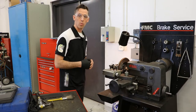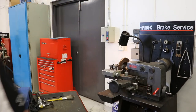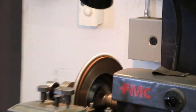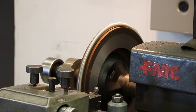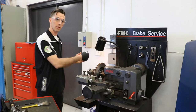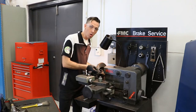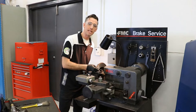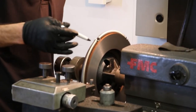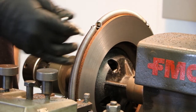At this point, we'll zoom in and have a look at the rotor cutting surface as we go through here. Once we're no longer contacting the rotor surface, that cut is finished. As you'll notice on this rotor here, we've eliminated all of the corrosion, all of the rust, and we have a nice even surface. We have no grooves, we have no hot spots, and we have no rust or corrosion.